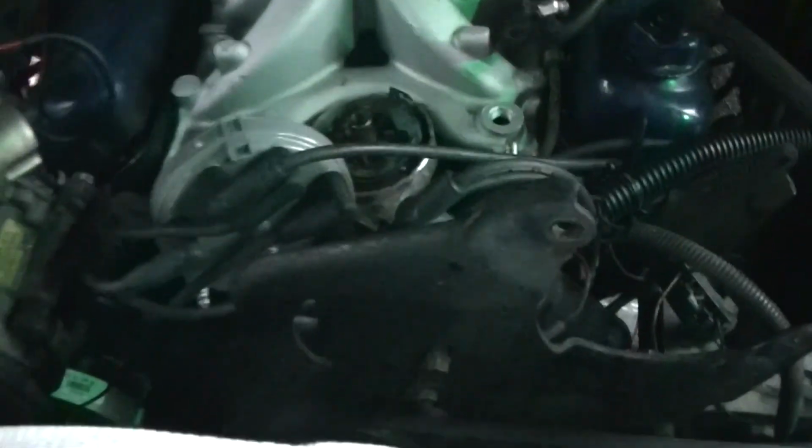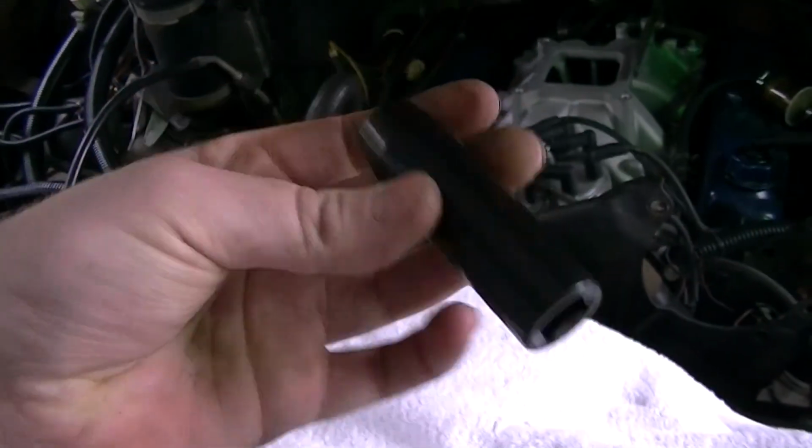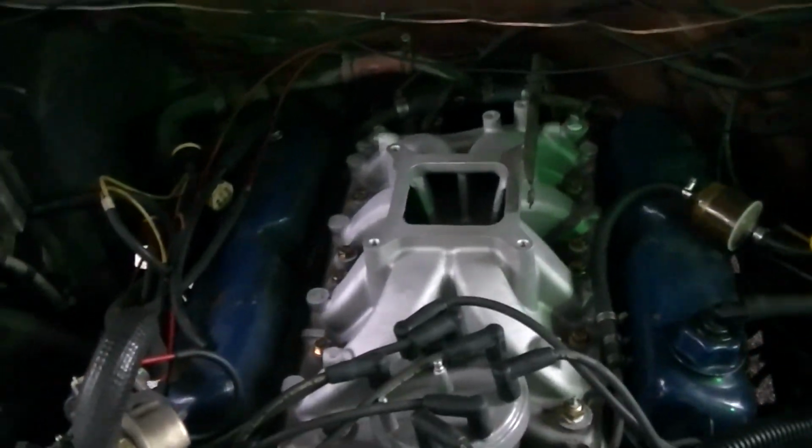We got these plugs here. And these, you're wondering, what the hell am I using those for? Well, on the back, as you can see, there are these little ports there. Well, kind of need to plug those up, or else it'll never ever hold water, ever. One thing with this intake, it is a bit of a tight fit, but she's in there. And the socket you want to use to torque down your bolts with is a 1/2. A 13 works, but it's a tiny bit loose, and you really want these to be snug.